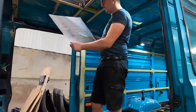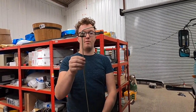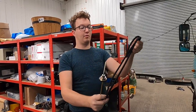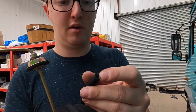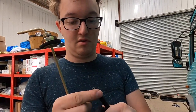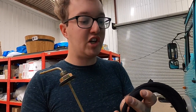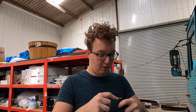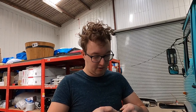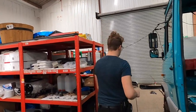This is our fuel dip that we're going to put into our diesel heater tank, along with some upgraded fuel hose — a proper fuel-rated rubber hose with a braided outer sheath. It's 4mm, which is what we're going to run to our pump. It's better than the Chinese plastic piping that came with the kit. So we're going to dip-a-de-dip — first step is removing this cap, which has a jubilee clip on it, so we need to undo that for the air output and then take this out.